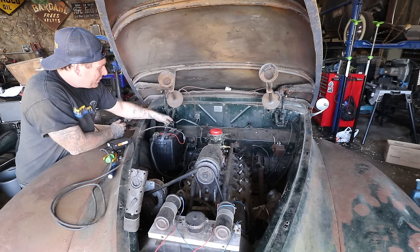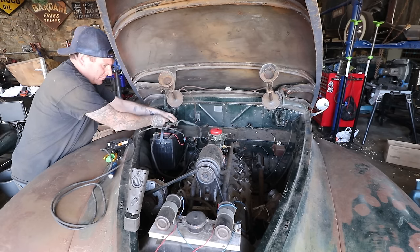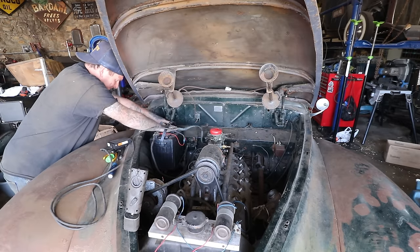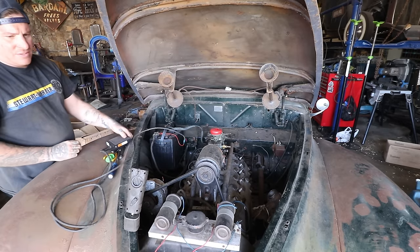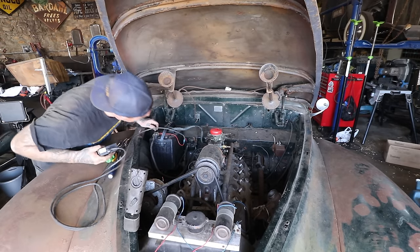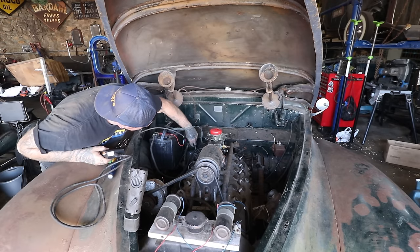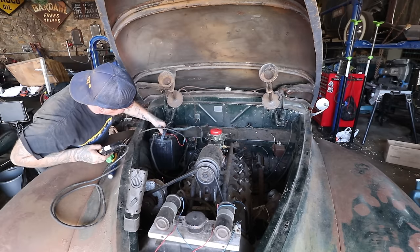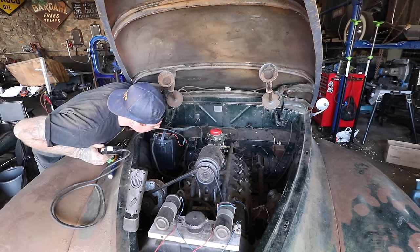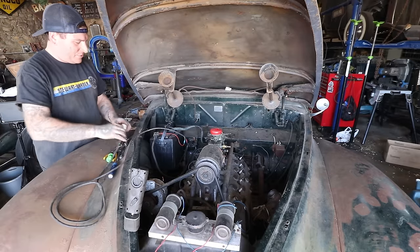So I am using a 12 volt battery. I have everything disconnected, so I'll run a ballast resistor to the ignition, not to fry anything, but this way we can just see if it cranks. See what happens. Okay, that's nothing. Great. Interesting. That's not a good start.